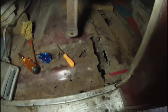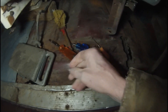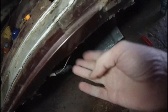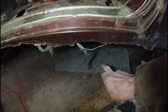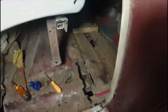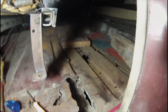I guess it's time — or past time — for a little update on what I'm doing here. Here is the condition of the driver's side floor. Pretty rough, some metal's pretty good. Biggest problem I see here is the actual body mounts are rusted away. Rockers on the outside are gone. What I had on here was just a piece of galvanized sheet metal held down with sheet metal screws, much like this one still is. And that worked fine. Really, even if I put new steel in here, it's not going to make a bit of difference to the way it rides or handles or looks or sounds. It's just — I'll know that it's got a stronger floor under it.